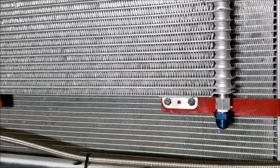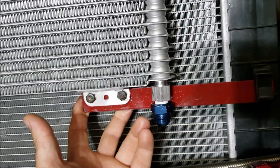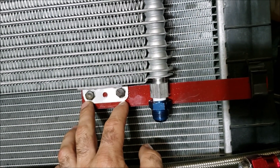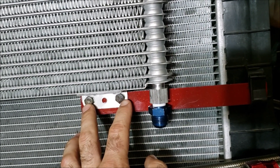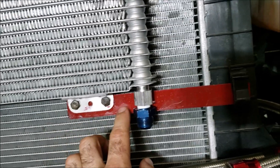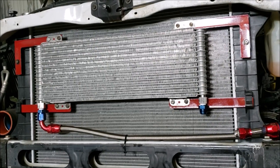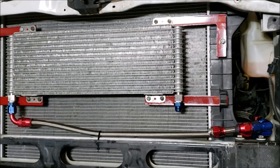As a final touch on the mounting: these two bolts here — we threaded bar stock behind the cooler with quarter-inch threads. We drilled these two tabs on the cooler out to quarter inch and tapped the bar stock behind it, using the widest possible points to make a nice strong mount, since obviously we can't use the factory mounting hardware.